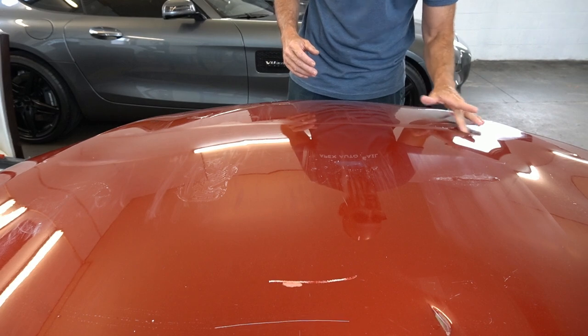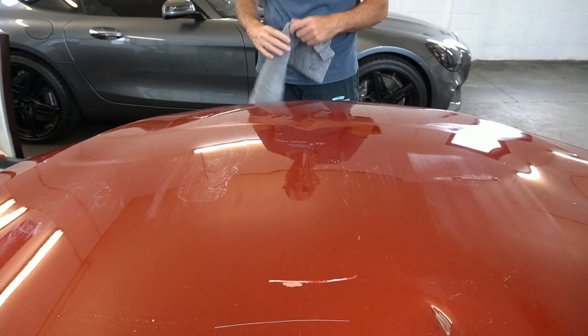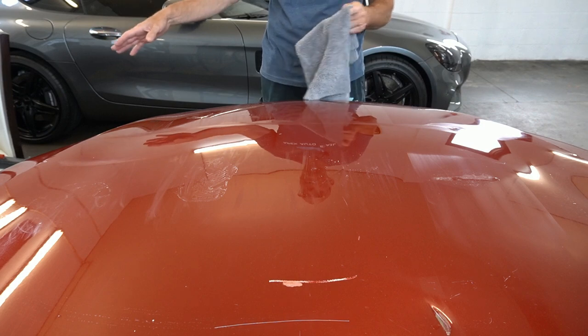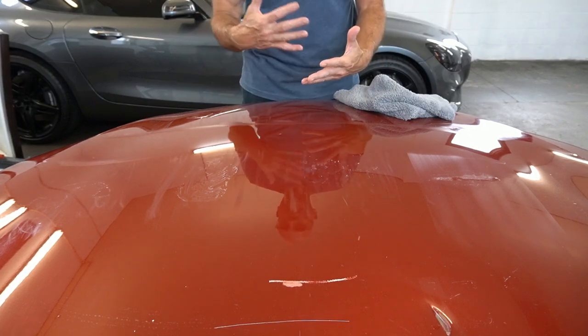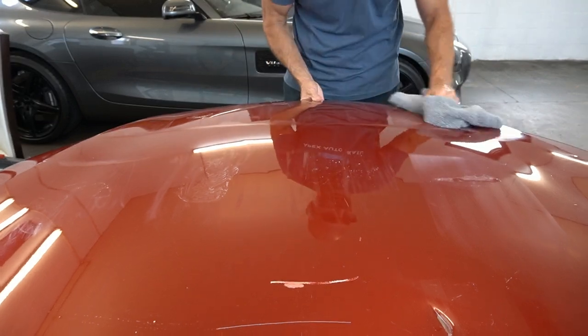It is starting to dry out a little bit, so you're not going to have a super long cycle time or open time before the product dries out with the rotary polisher. Again, a lot of that has to do with the wool fibers. They're dry. Airflow really, it's not constricted. It can go through those fibers and dry out any compound quickly.